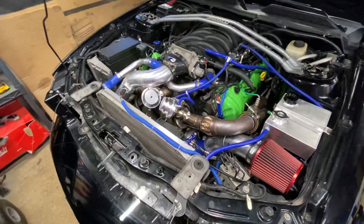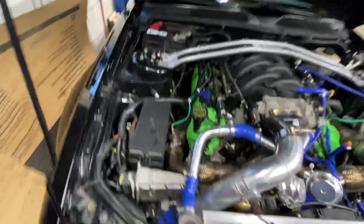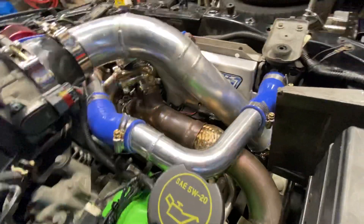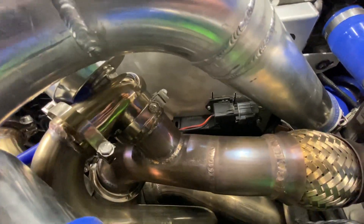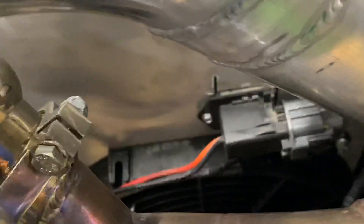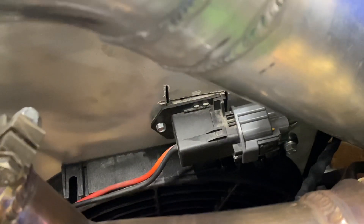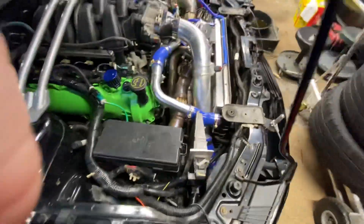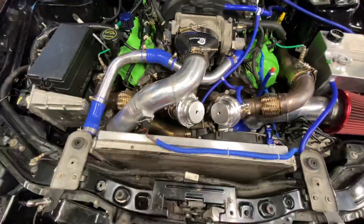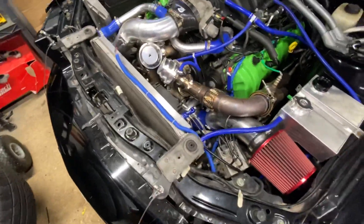The fitment was overall pretty okay. Another thing I had to modify was there's a part that comes on your original fan shroud — I'll zoom in right there. It's like a thermostat or something; I'm not sure of the part. But I had to put that in there, cut a hole in, and it plugs right up to its factory connector. It's some kind of thermostat — gets hot enough and it turns the fans on.